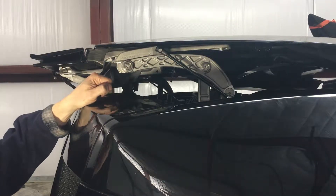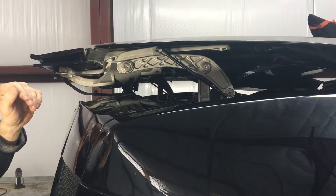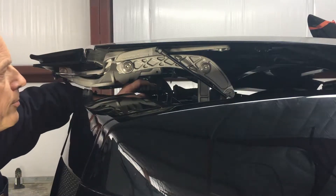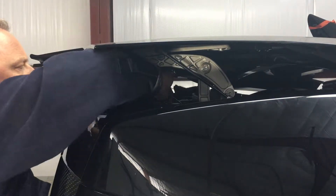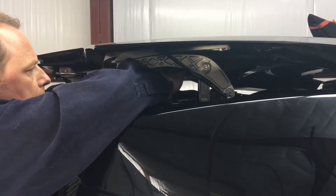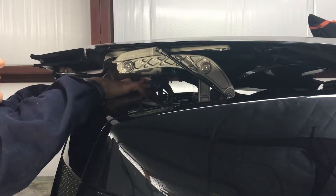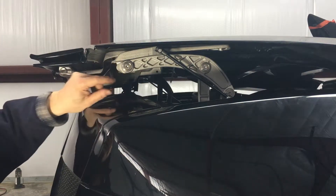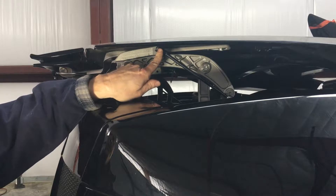Removing the hood is easier than you may think. We just have the engine cover partially open, not even up in the service position yet. All that needs to be removed is, first, the wiring harness unplugged. There are two connectors here. The little one is easy — push a tab on the side and pull it apart. For the big one, you push down this tab and pull the whole thing apart. Wiring harnesses apart. Now we're only having to take out a bearing bolt and the top of the hydraulic cylinder on each side.